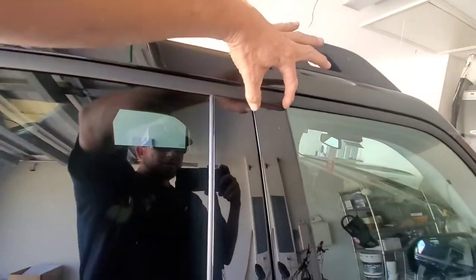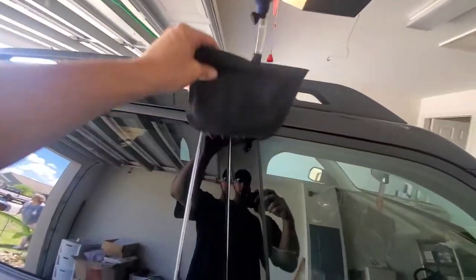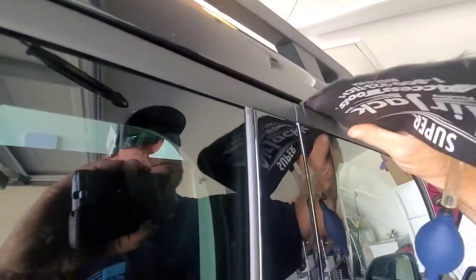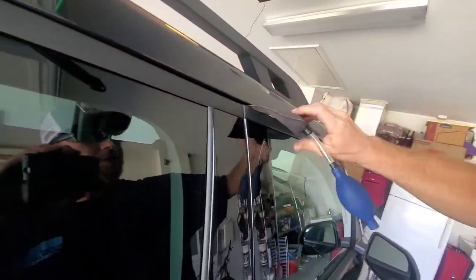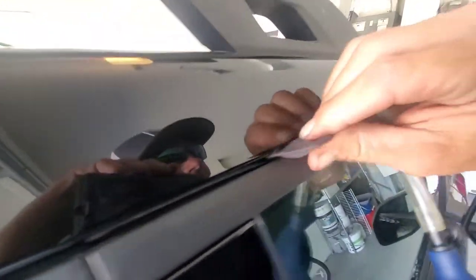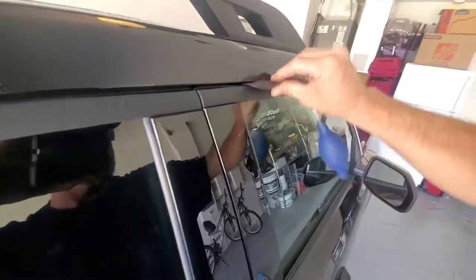Because this door has a plastic piece on it, we're going to go in through the top of the door to unlock it. I'm going to stick my airbag in that way. We'll just get all the air out of the bag, then get it in behind the weatherstripping. Push it through the door — be careful with your fingertips not to scratch the paint — and work it all the way through. I used two hands to get it all the way through, and you want to have it as far in as you can so the bag won't belly, because if it bellies it may dent the roof panel.